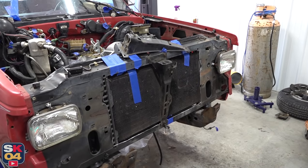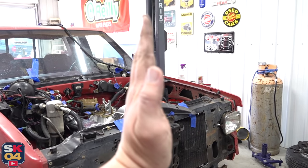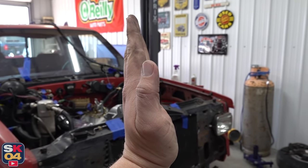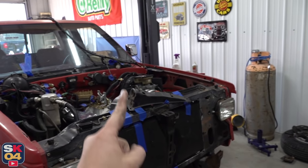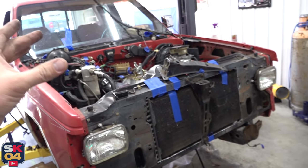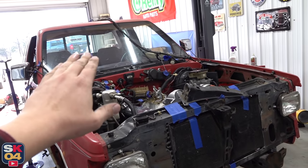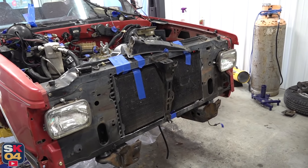Here's another look at that pulley from the top. I'm thinking about tilting everything forward. The way everything is positioned right now, there's a slight rake with the top of the radiator and fans going towards the truck, but I want to tilt everything out this way so the fans are pointing more up. I think that will be okay because I'm going to be running a cowl hood on this, which is vented at the back, so if I'm able to push more heat directly out through that opening, in theory it should work out pretty good.